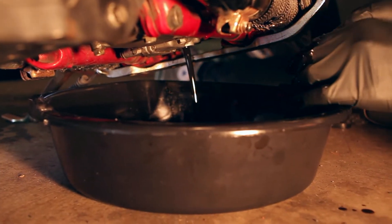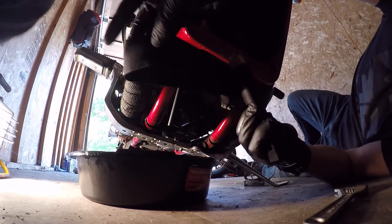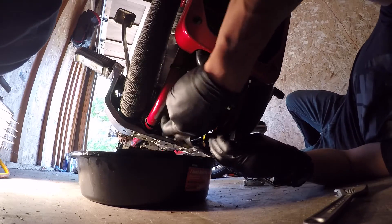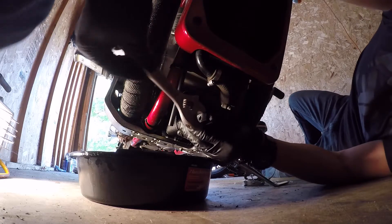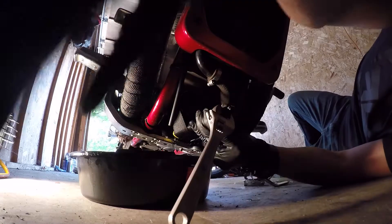There she goes! All right, so to get the oil filter out on some of these bikes it's a little bit cramped in terms of space. This tool right here is pretty cool — it's a little strap attached to a shaft, and you just turn it a bunch of times and it'll tighten up and get the oil filter loose. You're supposed to use a 3/8 drive ratchet as well, but the crescent wrench did just fine. You basically keep turning it until you can loosen it with your hands. All I had to do was open the battery door, tilt the battery, and pull it out.